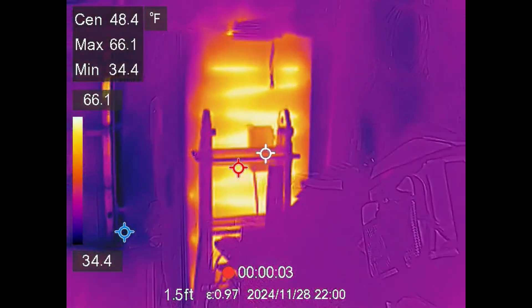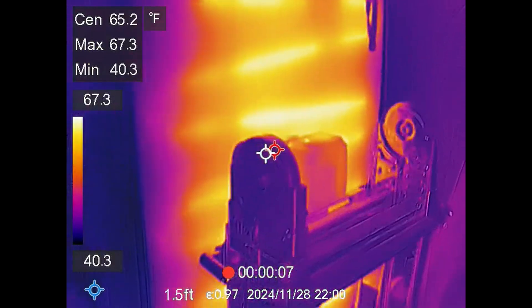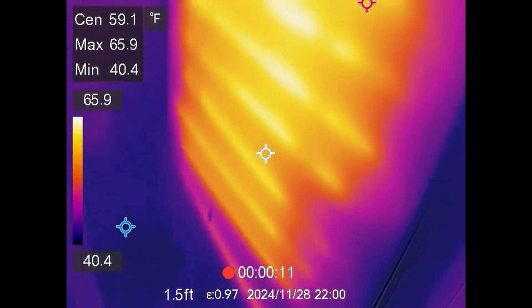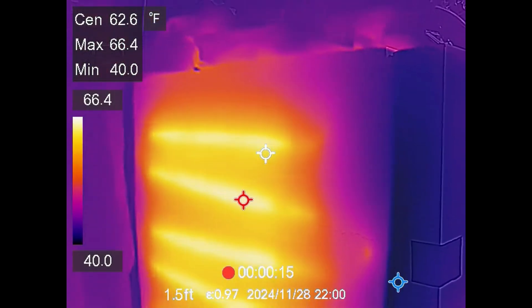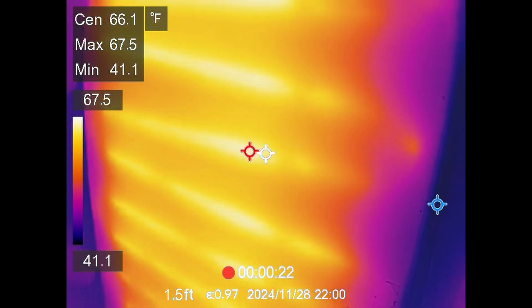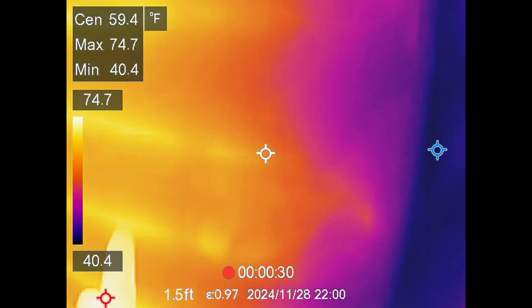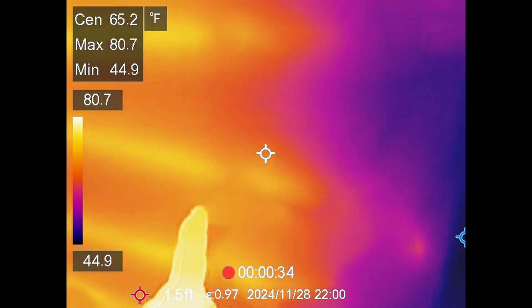The freezer is running and you can see the condenser coil is wrapped through the outside of the freezer — that's where they get rid of the heat. You've got cold lines from the evaporator plates on the inside and hot lines on the back side, cranking out about 67 degrees in that area. You can find a refrigerant line if you want to know where to drill so you don't hit it.